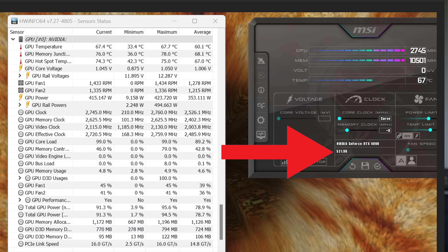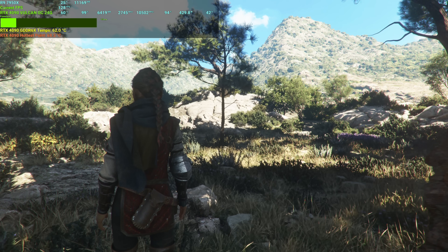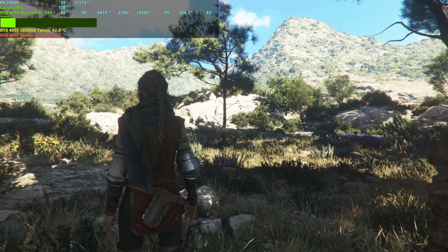I disagree with the advice in Optimum Tech's video — I think you should be undervolting your RTX 4090 for the best efficiency during gaming. Also, when he was doing those tests he may still have been on the beta driver; the official launch day driver is what the public uses, which might explain some weird results. There's also another possibility: he could have been in that 1% echelon of people who got poor silicon. When it comes to how NVIDIA bins these products, they'll have standard deviations and make power profiles accordingly — the same is true for AMD and Intel with CPUs and AMD GPUs — and those profiles are made more aggressive to accommodate the poorest 1% of silicon so they don't get returns.